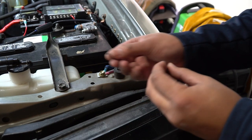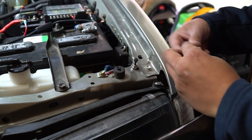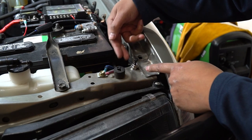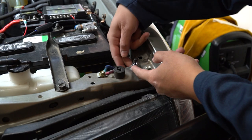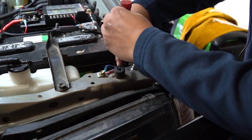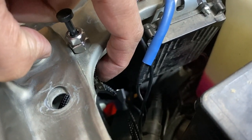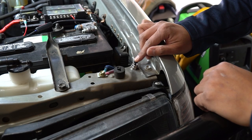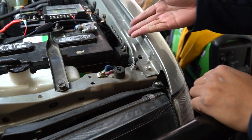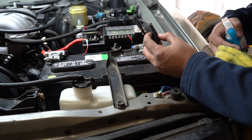On the other side you're going to have a washer, lock washer, and a nut — thread those on from the other side and tighten up. It's a little tight with a bigger battery, but you can put a 12-millimeter in there angled and tighten it. Once it's all tight, connect the other end of the harness into the pin. When the hood's closed, it disconnects the circuit so the light doesn't stay on; when the hood's open, it connects the ground and makes the light turn on automatically.